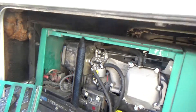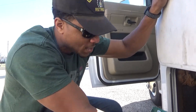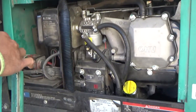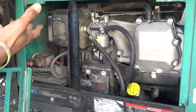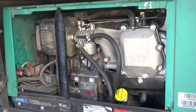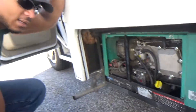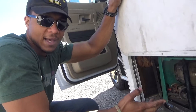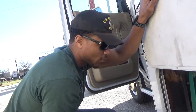If the generator starts to give you any issues, there are a few things we recommend. First is just a visual inspection — does anything look wrong? Has any tubing popped off? Is there a leak? Do any wires look wrong? Do a visual inspection. There's a filter behind here with a wing nut, and then another wing nut inside — you can check all that to give yourself the best opportunity to get it running again. Also, when your engine fuel runs down to a quarter tank, it's automatically going to stop the siphon to this generator. So maybe it stopped because you ran low on gas. Before you get to where you're going, if you're not going to be at a campsite, make sure you fill up — otherwise the generator is just going to stop running and you won't know why.